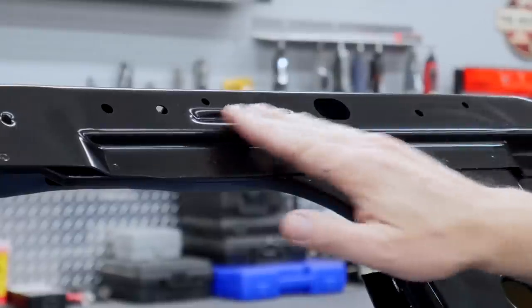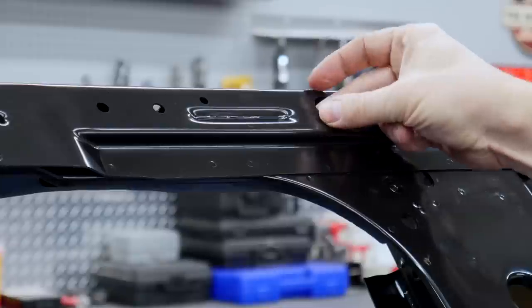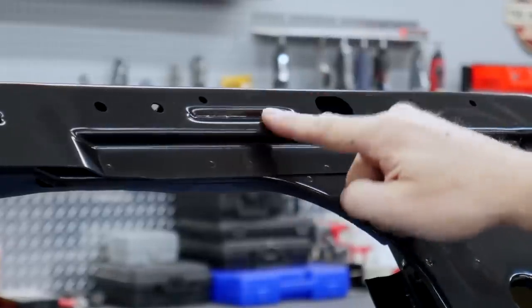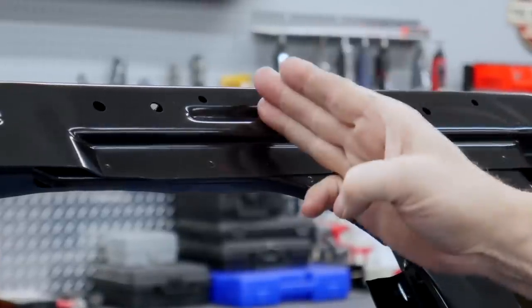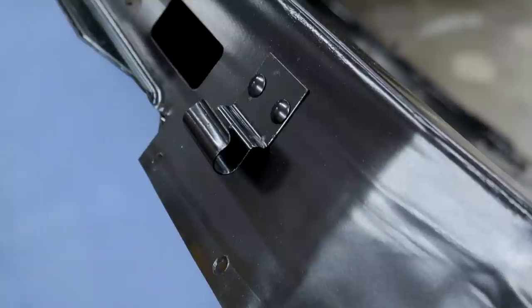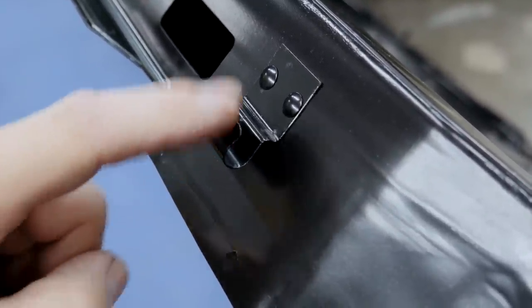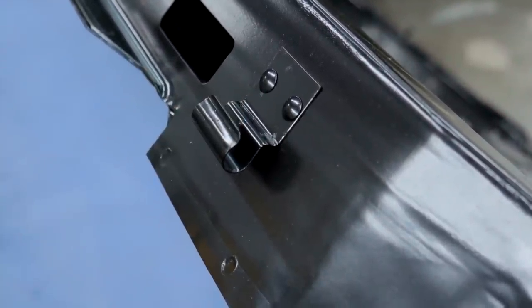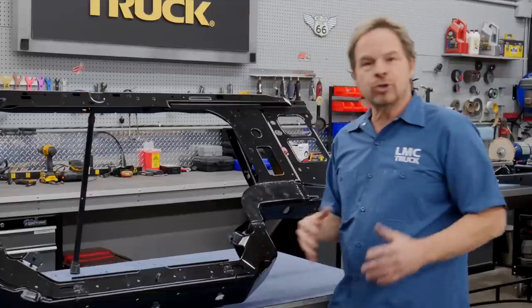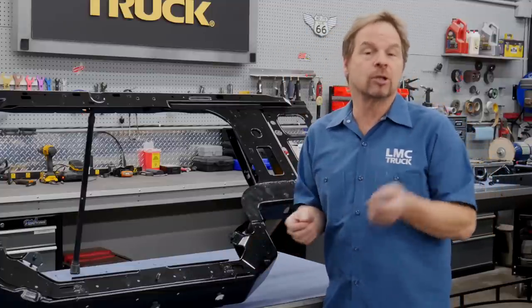Right here on top of the upper part of the radiator support, being made of a heavier gauge steel, these reliefs are also stamped in to give even more strength to these common prone areas that typically stress crack. Another cool feature is that the jack handle clips are already pre-installed on the support, riveted in place, which just saves you time. The support also comes covered in a thick EDP coating which helps with corrosion and looks good doing it.